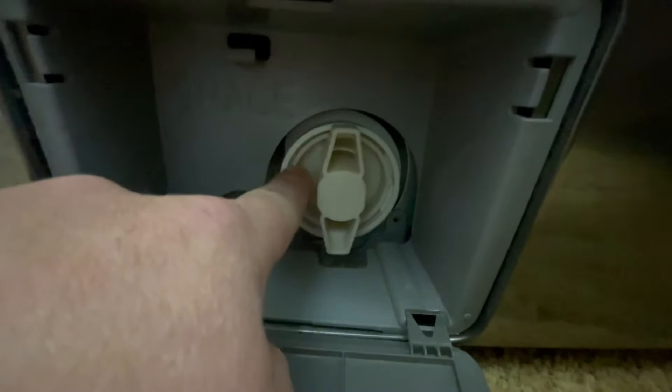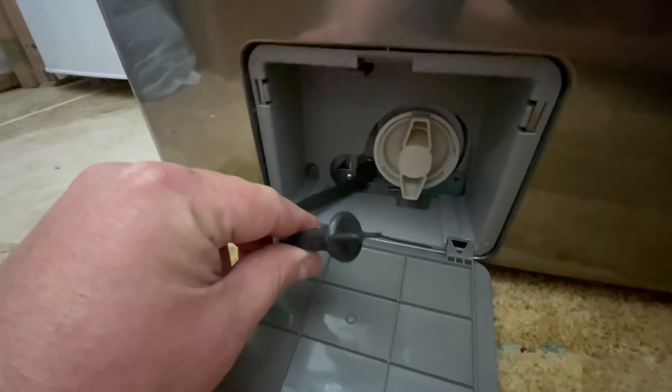Hopefully you're able to get the spin-only cycle running so it pumps all that water out. When there's water in the reservoir, this thing is going to be submerged — so if you pop this open, it's just going to come flooding out. That's why the slow drain tube gives you control.